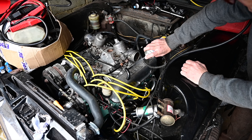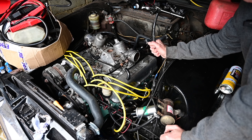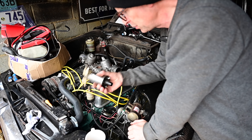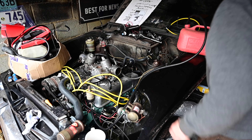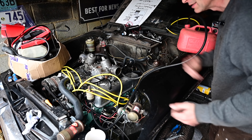The confusing thing is every time I crank it I do hear that little 'fuf-fuf-fuf' just like something is trying to do something but not quite doing it. This is very confusing, this has taken all the fun out of it. That fuel line - the hard plastic - that's definitely what needs changing before I drive this. In lieu of any better ideas, I'll put the original coil back on and see if we get anything better. As far as the carburettors go, I can smell something every time I crank it - a couple of fuf-fufs at the beginning then nothing else.